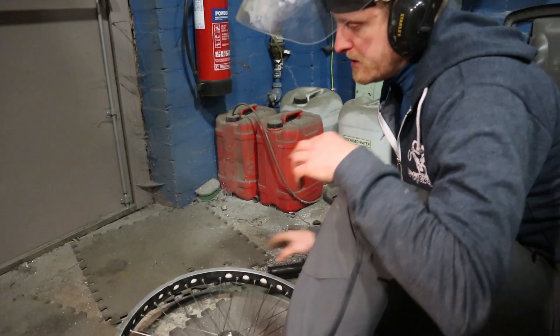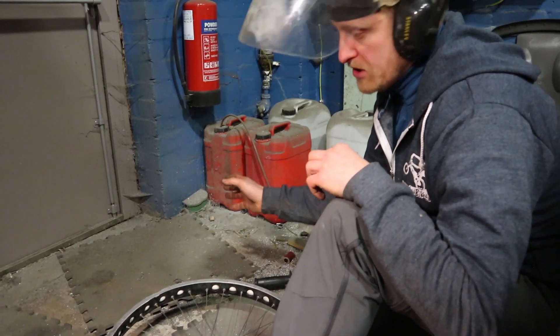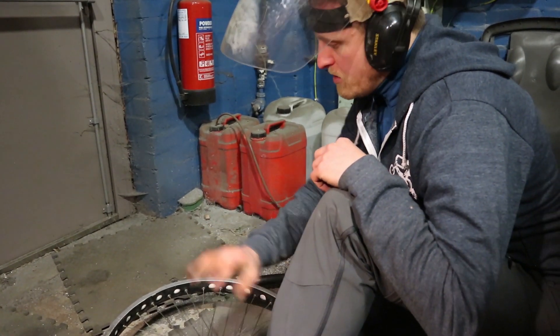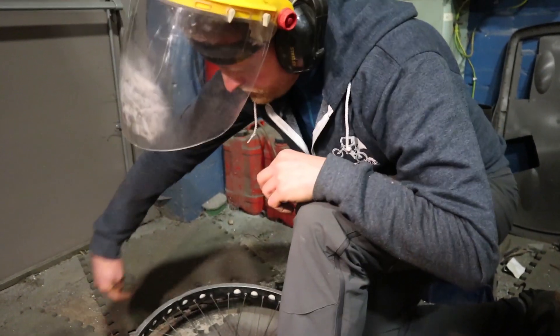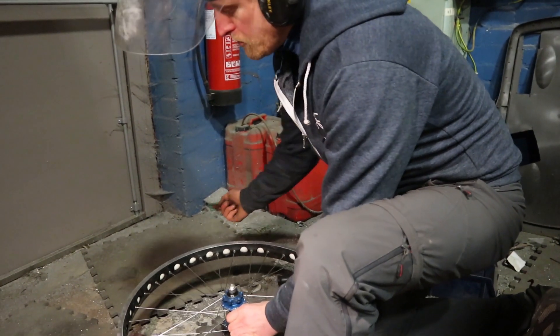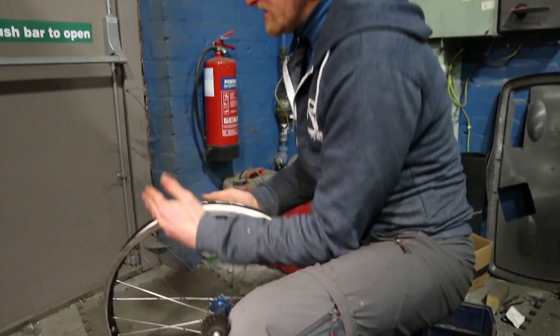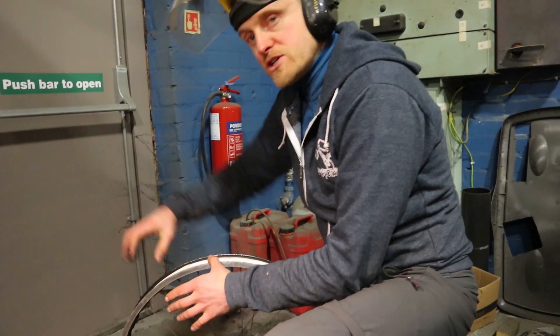You'll see I was only really grinding in one direction. If you go backwards and forwards with the disc it just smooths back off what you've just done. So if you just drag one way, the grinder will run one way on one side of the rim, and then when you flip it over it will run the other way effectively. So you've got your grind at this angle this way and that angle that way, and hopefully you get the brake working in both directions.